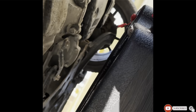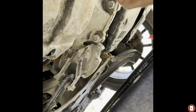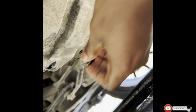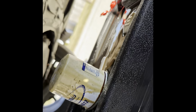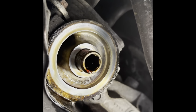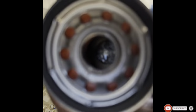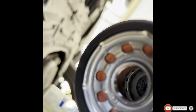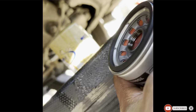Alright, so it's done draining. I'm gonna put the drain plug back in without messing my fingers up and get right back to y'all. After I did that I took the filter out — it's like a housing, you break that, take it out, let it drain. Then with the filter you take some oil and rub it around the gasket right there and put it back in and hand-tighten it.